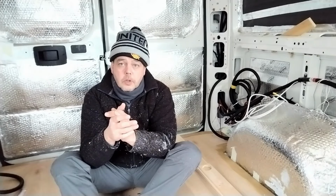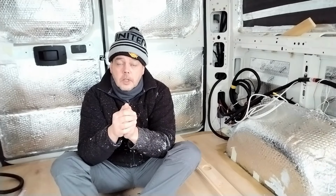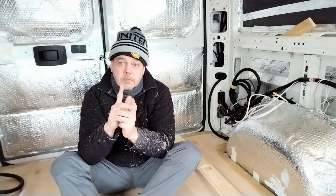Oh, no, they don't. At the side of the puck lights, you'll get 2 wee plastic squares, and they'll have the copper bit, the clip, that inserts into the hole, which holds it all in place. That is going to cause you problems if you haven't got an exact 58 millimeter hole. So you're going to be filing all around. Then the circle hole becomes oval, and next thing you know, you file too much over the edges trying to get the thing in, and when you put the puck lights on the roof, you can see the circle is actually slightly bigger.